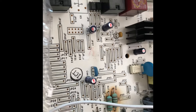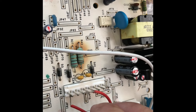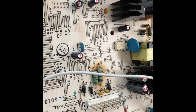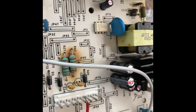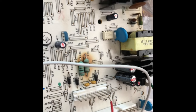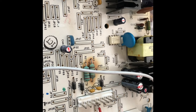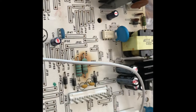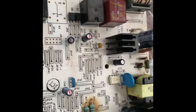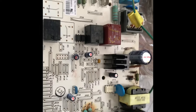What I did — I jumped it with the board on the fridge. I did pin four, then I jumped it over to four right there, then did five. So one, two, three — four is the evaporator motor; jump it to the last pin, then do the next one up. I found when I jumped the evaporator motor, the compressor motor kicked in. So I didn't need to really jump the compressor motor, and bam, it would run — but then it wouldn't keep going consistently. I just replaced the board. Everything's new — two new motors, new board — and we'll see if this works.